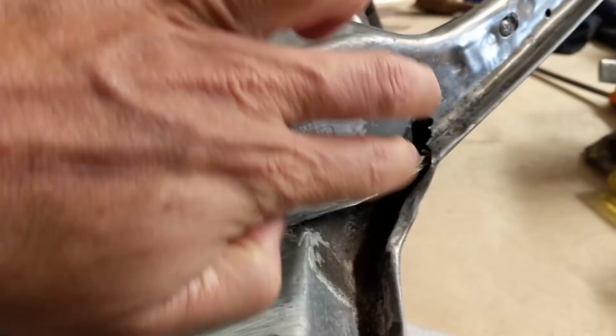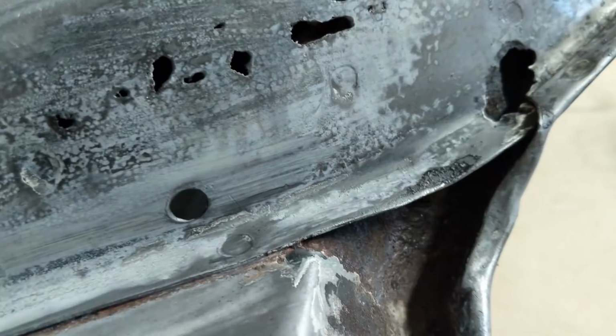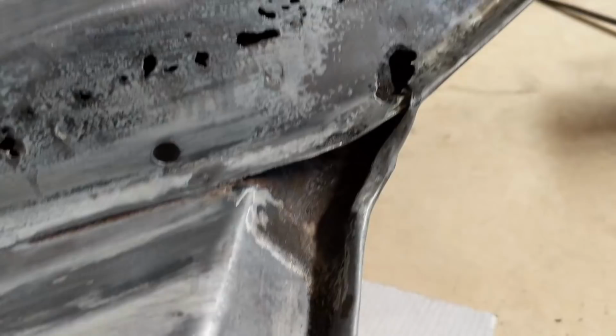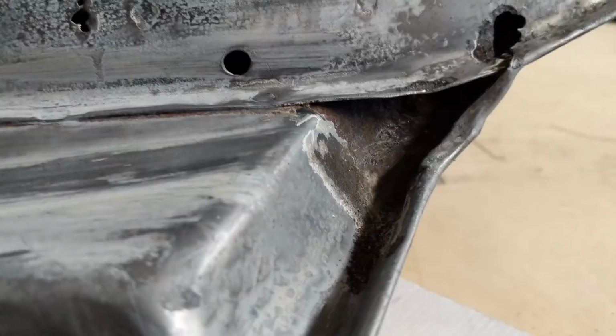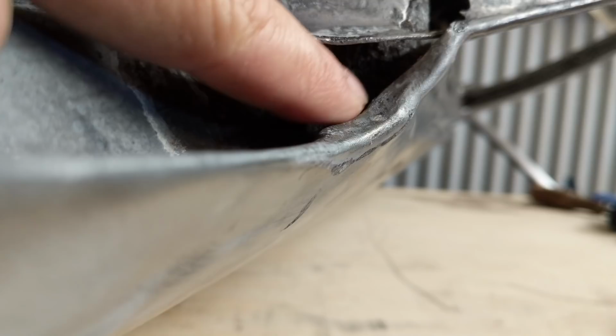I think when these things rolled out the factory door, they bogged this whole inner section up here to stop water getting in from where the two panels meet. But the technology of the bog back in those days, and obviously time, has allowed water to pool in beside there, and that body filler is probably a little bit porous. And as you can see, it's eaten in here, and also eaten straight through here, which is a real bastard